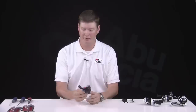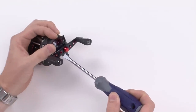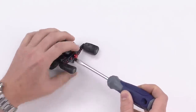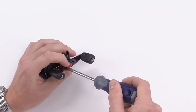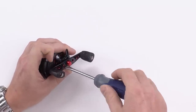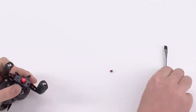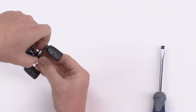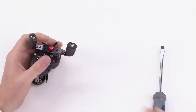To get started, I'm going to show you how to replace the handle and the knobs on this Revo SX. It's pretty easy. I'll take my flat screwdriver and remove the retaining nut that holds the nut retainer in place. Slide that in, back off of it a little bit, and use your finger to bring it out the rest of the way. Set that aside — that allows the nut retainer to come off, and now we can remove the nut.